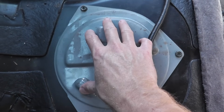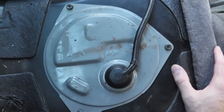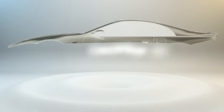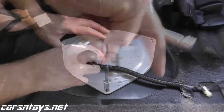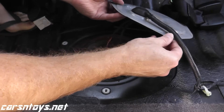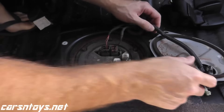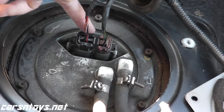If the fuel temperature sensor does need replacement, we do have a separate video on that, and I'll splice everything together so it's fluid. Let's start by removing this top plate. Once you remove the plate, you have a grommet right here — always a good idea to remove if you can. Let me come in for a close-up so you can see exactly what we have here. As you can see, we have two fuel lines as well as two harness connectors.